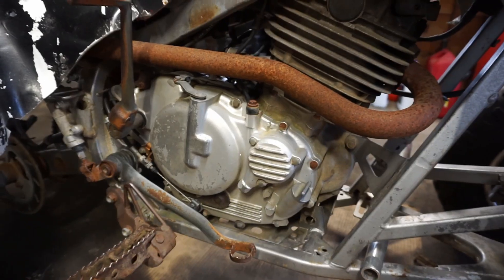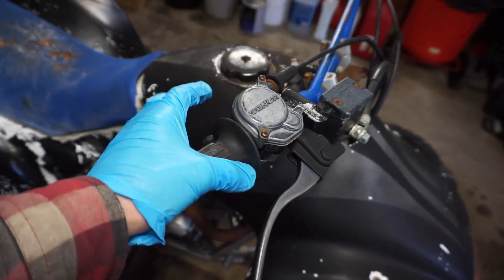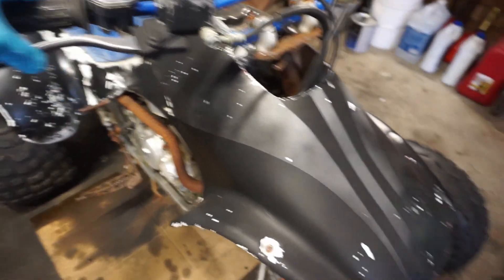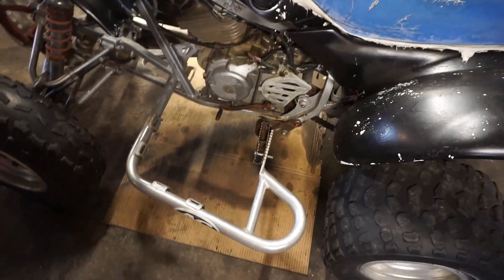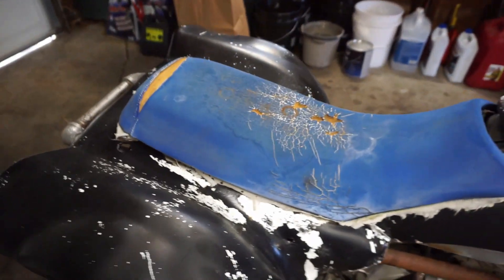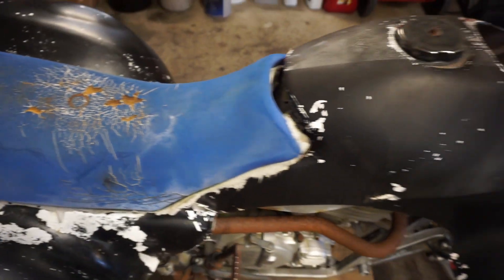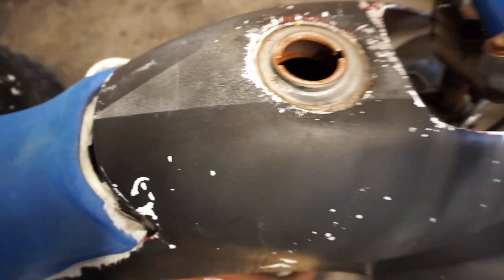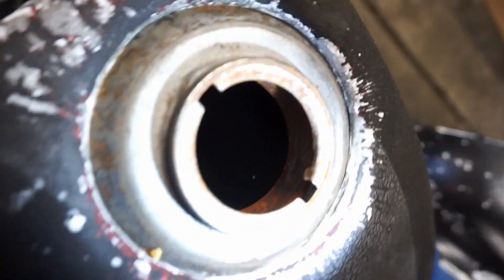Pretty cool engine on this thing. Looks like there's some gas leaking out of the carburetor. The carb isn't locked up though — that's good, that moves. If I push the brake in, the brakes lock up, yeah. They're really rough on this thing. It's got some nerf bars but it's missing the netting. Got the stock exhaust on it, all rusted. The seat has seen better days but the foam is still in decent condition. Gas tank — looking in there — a little bit of rust but not horrible.